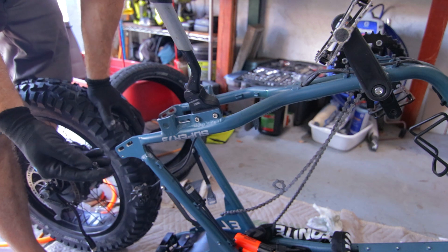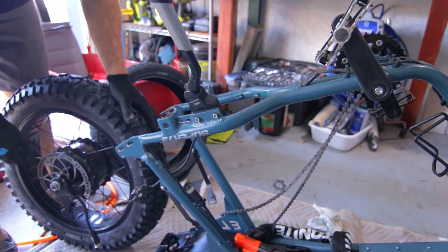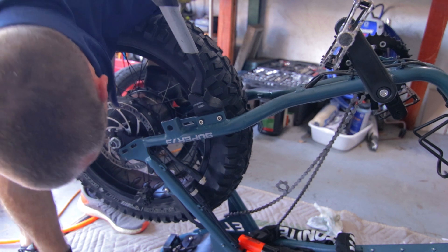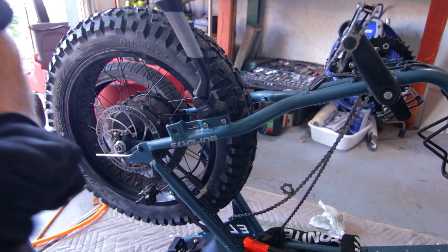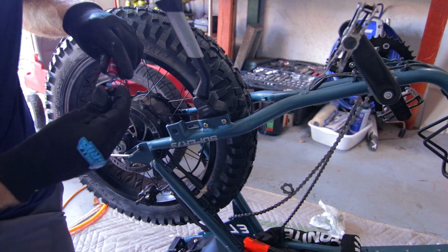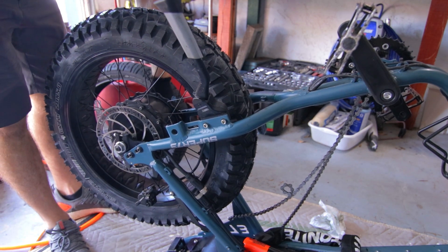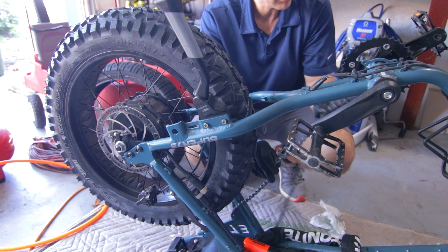Time for the reassembly. When putting the back tire on, just have two of the bolts handy so you can put them in once you've got it perfectly in place so it doesn't fall out. I had a little tube of thread locker I hadn't finished, so I'm finishing that one. All I've got to do is put a drop or two on these — nothing crazy. I like to do the chain next before throwing the calipers on, and really before securing all four bolts, I like to make sure the chain can get back on correctly, just to confirm there are no problems.